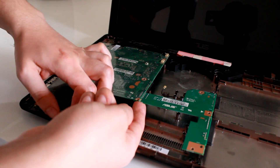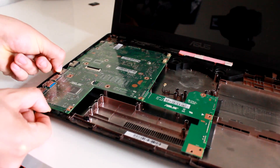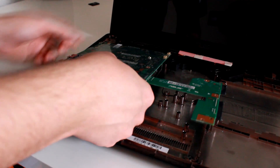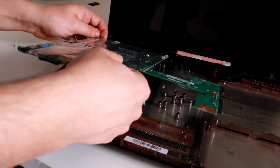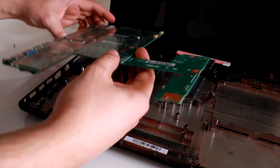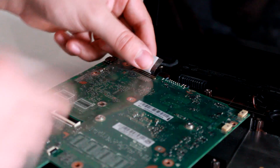Try to be very gentle with the PCB. Hold it by the edges. Don't touch the circuit board and of course remove the SD card as well. Just don't rush it — give it some wiggle and try to be patient. These PCBs are very fragile. The PCB label is held by tape on the motherboard.